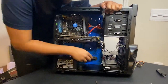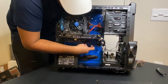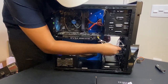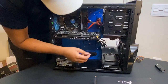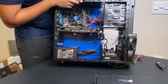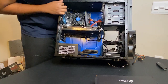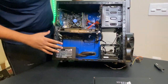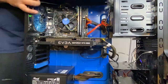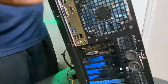To make sure our cables are cleanly routed, I'm going to bring them from the back and route them through this grommet right over here so they look as clean as possible. Once everything is plugged in, make sure all cables are pushed to the back so they're not visible. Route these fan cables to the back as much as possible. I'm probably going to zip tie these together so they look a little cleaner. Do a visual inspection — everything looks clean, everything looks plugged in. Now we're ready to plug in our power supply AC power, hook everything up to a monitor and keyboard, and we're ready to go.